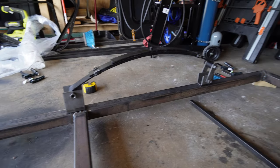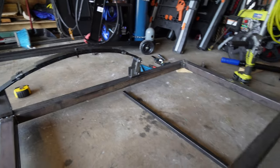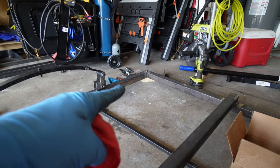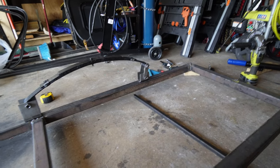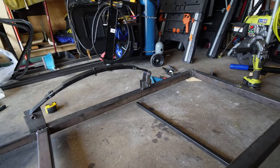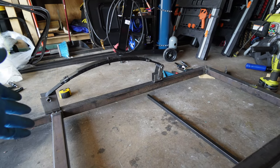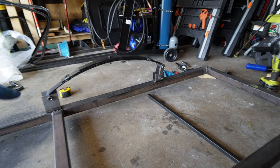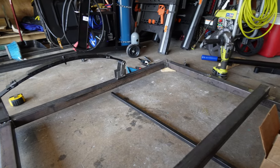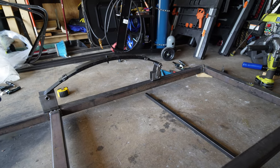Here is the setup with our leaf spring. Our center point for our axle is about 35 inches from our rear end, which means we have roughly 60 inches to the front of it, so we have a good balance. The rule is 60-40 — 60% of your weight you want in front of your axle. This will easily put us there since most of the weight is going to be in the majority of the front of the trailer anyway.